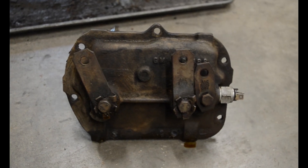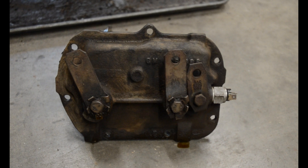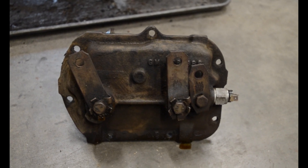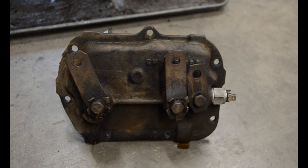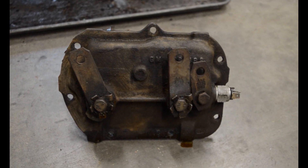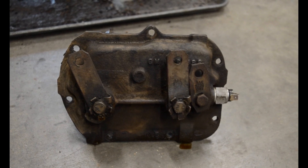Here's a view of the side cover. You can see the three shift levers. I'll actually take these off once I get it in the car because I have a Hurst Super Shifter that's been modified to work with a Saginaw, so I don't actually need these — I'm just leaving them on there for now to keep everything together. This is how you identify one. If you have a Saginaw three-speed, it doesn't have that third lever to the right. So if you ever find one and think it's a four-speed but it only has two levers, that's a three-speed — you probably don't want it.